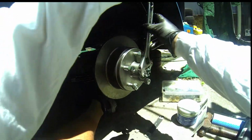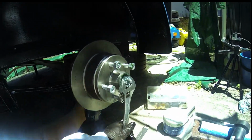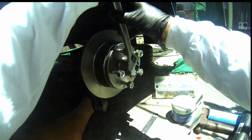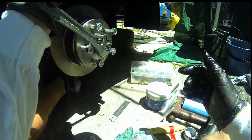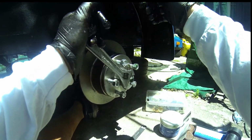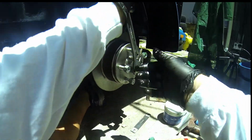And all I do is I just tighten that all the way down on top of the washer. Okay, just tighten it all the way down on top of the washer like this, so you get it nice all the way down, and tighten it as much as you can the first time around. Really give it a good tighten. There it is. Look, and you can actually hear at the back the pressure of the oil, the grease inside, actually starting to sort of tighten, which is what you want. So tighten it up really good.